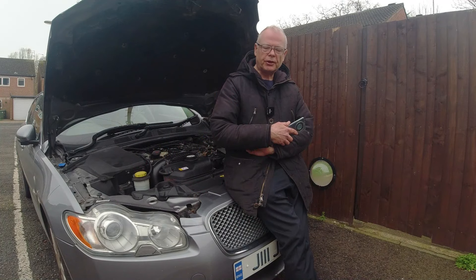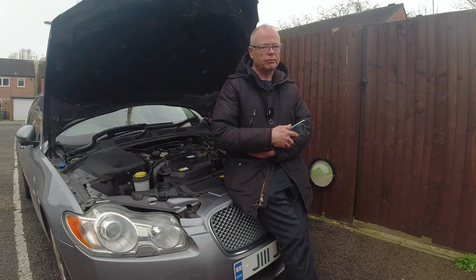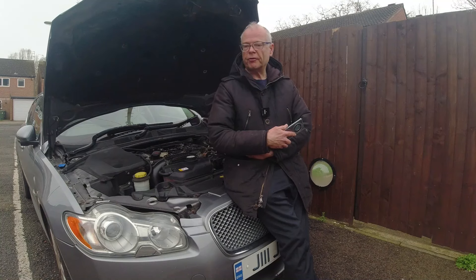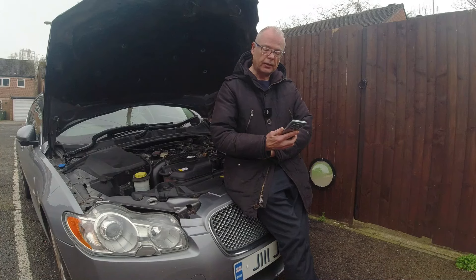Hello again and thank you for joining Jeff and Jenny's Classic Restoration. We're back with the Jaguar for one more week. If this doesn't work then I'll have to give up, but I'm not one for giving up. As I mentioned last week, I think the DPF filter is clean — loads of muck came out of it. Still got the warning light on, but one of the other fault codes is P00BD.